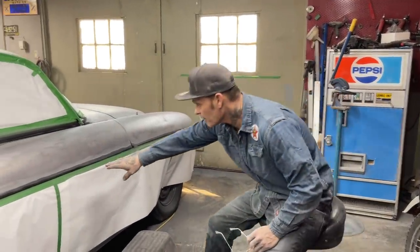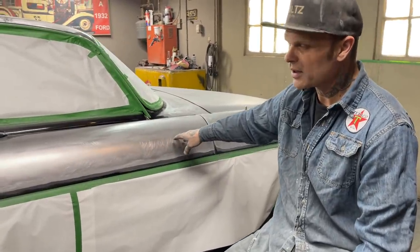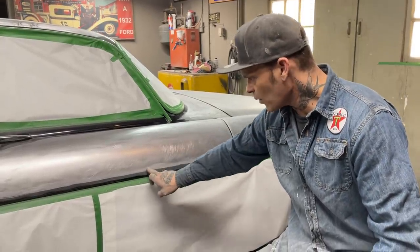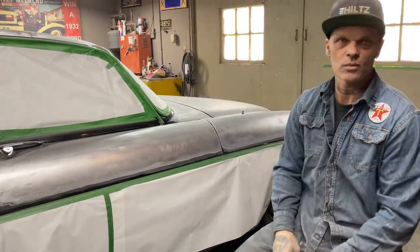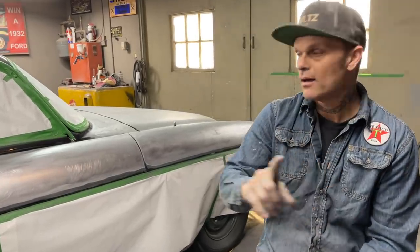And it's going good. But right on this part right here, I'm going to have to sand it. I'm going to have to be careful when we prime it. Take notice to be aware of where all the paint is feathered on that edge when we block the primer out. We want to make sure that we lose that feathered edge, and all the way around, we want to lose it. The only way that we'll get that is with a guide coat.